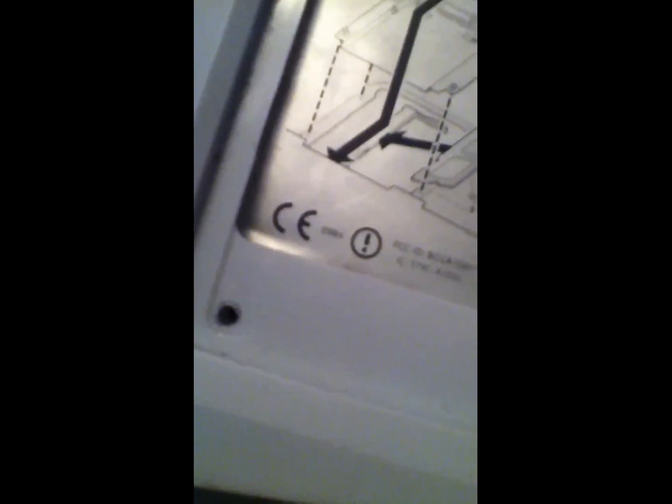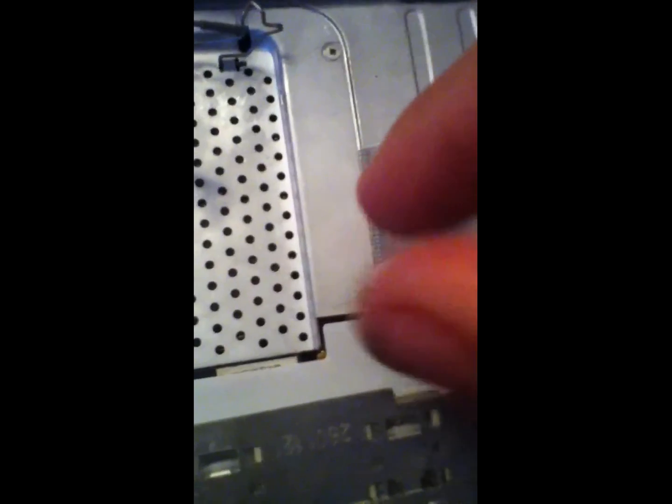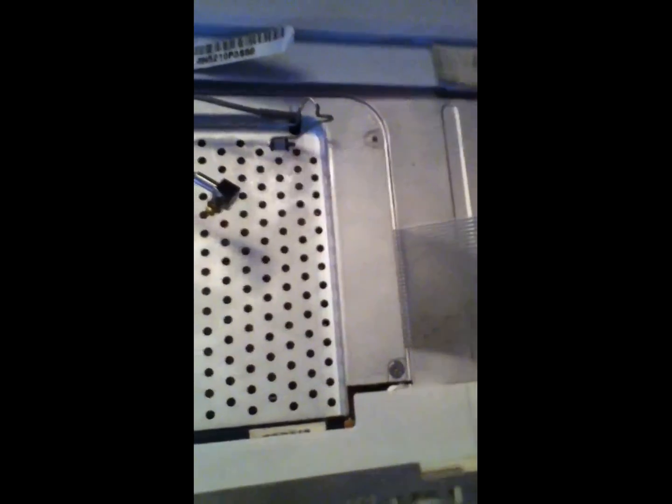Put the airport card over here. There should be nothing there — I just have to unscrew these screws. You guys have to take out the RAM and the keyboard. After that, you have to unscrew these screws over here, here, and here. There are no other screws around anywhere. I ended up having two screws that are threaded so I can't unscrew them no matter how hard I tried. Then what you want to do is put your screwdriver on flat tip here, undo this, it'll come over, and then this entire top part should come off. I'll come back to show you guys the wire that's going to have to be unplugged.